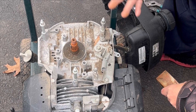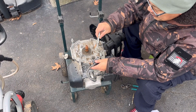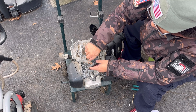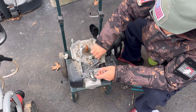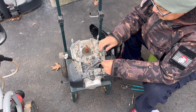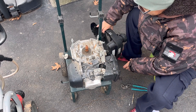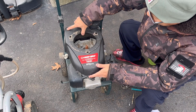That's a shame. The magneto would probably work, but I don't have a flywheel for this GCV 160. I guess I'll wait for one - if you guys have one, send it to me. So I will not be fixing this one today. I want to see if this magneto fits - I find it hard to believe Honda would make several different magnetos for their GCV engines. GCV 160s are the most common engines, so if the bolt pattern fits, it should work. I just need the right flywheel.